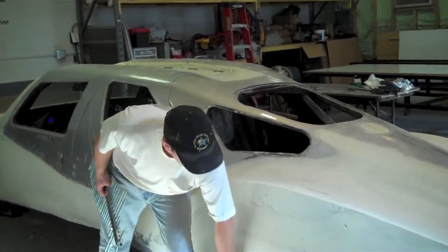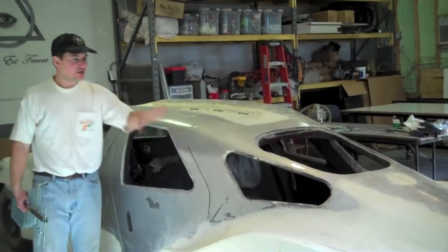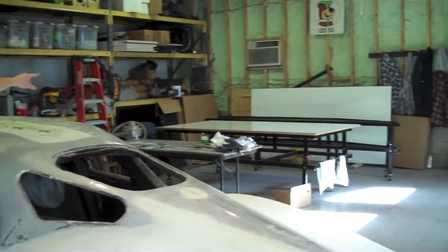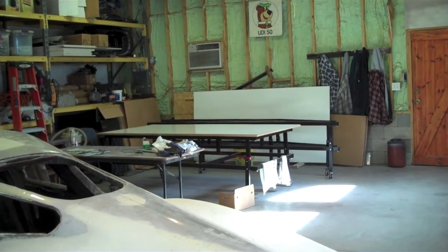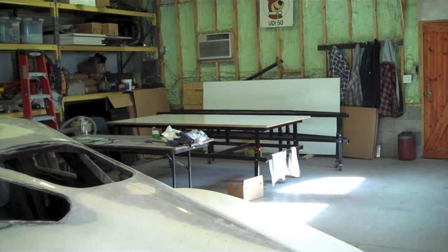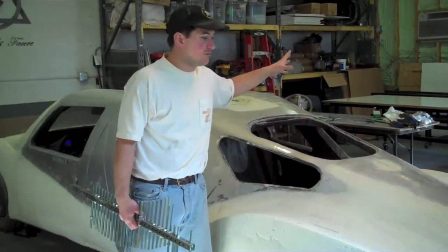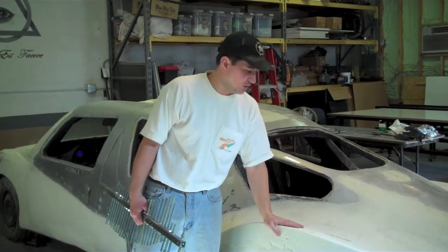We still have a bit of a hump here because our rear tires do turn. We're going to be replacing the fiberglass skin with carbon fiber. Those white tables and the white board in the background are four-by-eight sheets of tile board that have been waxed up — we have special tables that we built for making molds out of carbon fiber. We'll pull a mold off the side of the car, set it up on the tables, and do some vacuum forming using carbon fiber and honeycomb composite to make strong, lightweight components.